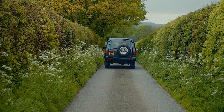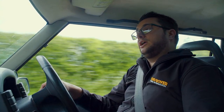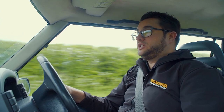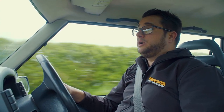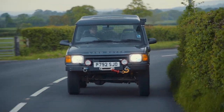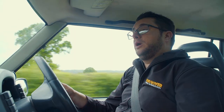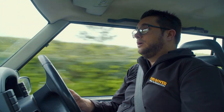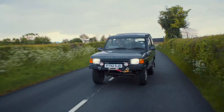If you're driving a manual model, take note of how much play there is when you change gear — too much slack in the driveline could be down to a worn transfer box input gear caused by oil starvation on the splines. Brit Part do an uprated cross-drilled gear which fixes this issue. So that wraps up the buyer's guide for the Discovery One — they're brilliant rugged vehicles, but a collection of problems can prove costly, so buy wisely. For more videos on buying Land Rovers and how to look after them, check out the other videos in the Brit Part Workshop series.